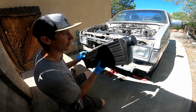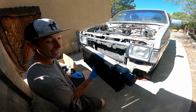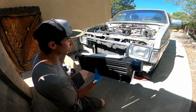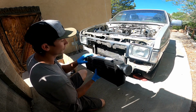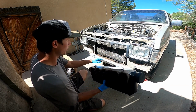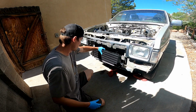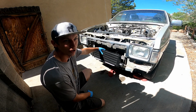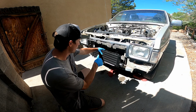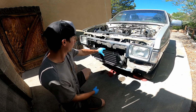So I had this metal piece laying around. It's actually pretty thin, but it's all I have here, and the truck doesn't run, and my welder is out of the office. So this will work for now to get it down there once it's running, and then I'll weld a better plate. I'm just gonna use this bracket that's here and kind of just mount it to it, because it only needed to be like 2 inches longer to make the bolts line up. So self-tap that into the bracket and then weld it at the shop later on.